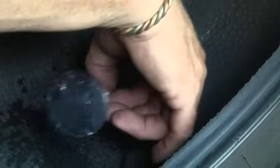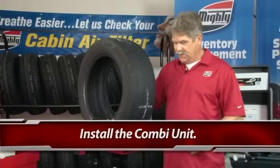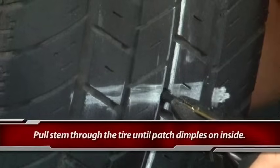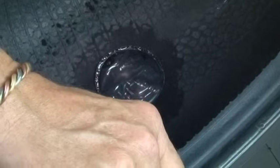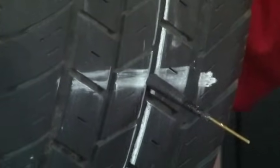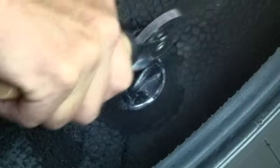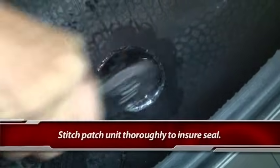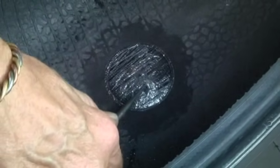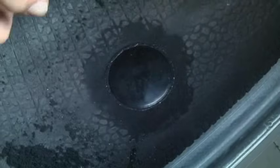The cement is already dry — you can see how flat and soaked in it looks. We're going to insert the wire lead. As soon as you can grab onto the rubber part of the stem, pull it on through until you see the dimple on the inside. When you release, that will seal the injury and leave the repair unit on the inside. Then the most important part: take your stitcher, start in the middle, and press firmly, pushing that cushion gum into that texture area. The poly needs to come off — pick it loose and peel it off just like this.